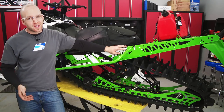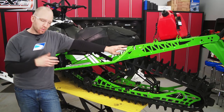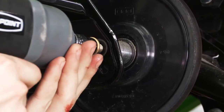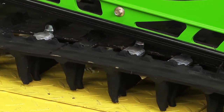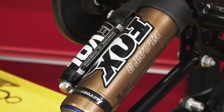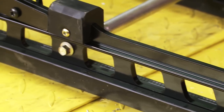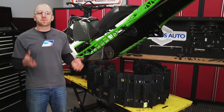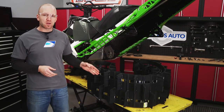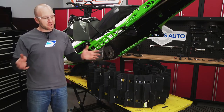And now the biggest changes yet — the track and rear skid both need to come out so that 2016 parts can go back in. All 2016 parts will be going back into the rear skid frame: new rails, new torque arm, the whole nine yards. We also have an extra cool set of Fox floats for both the front and rear arm — the rear arm is Kashima coated and both floats are EVOLs. The stock sliders are going out in exchange for a set of performance wear strips with DuPont Vespel inserts, which increase durability and keep the track running truer. And the track going back in is a Power Claw with a three-inch lug and three-inch pitch — it is as impressive on the mountain as it is on the dealer showroom floor.